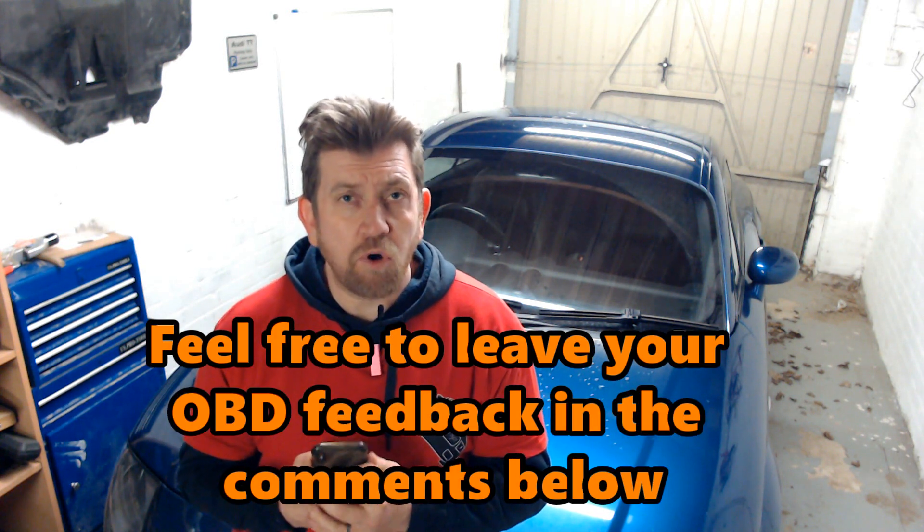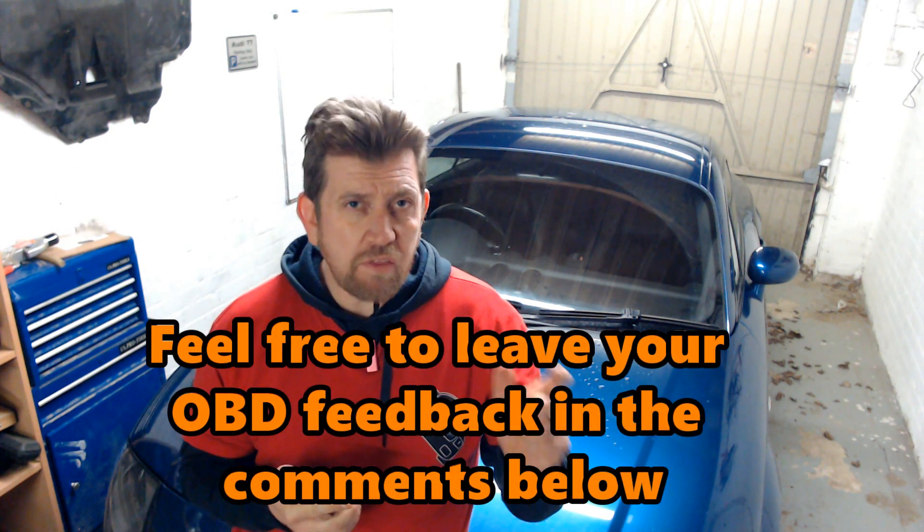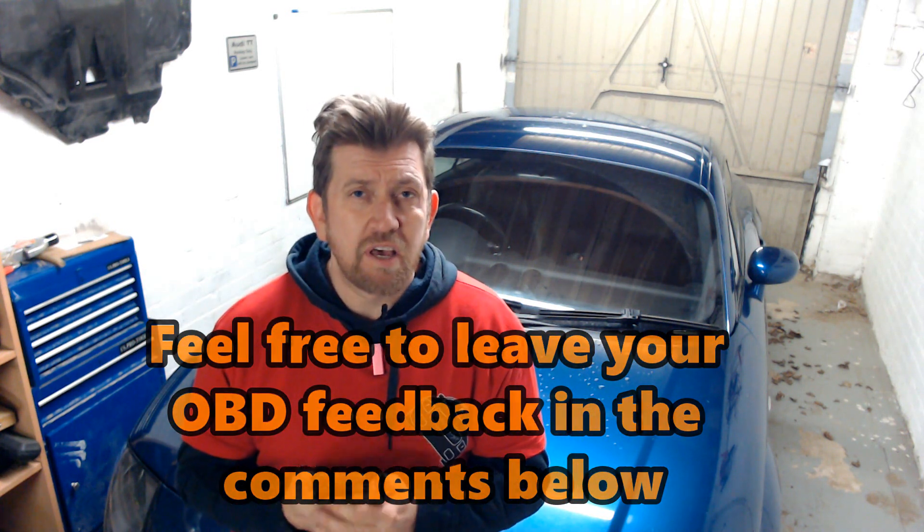It also saves a hefty garage bill. I would say, if you're doing any maintenance at home on your Audi TT, then one of these dongles is an absolute must for your toolbox. In fact, if you're taking the car out anywhere, I would keep it in the glove box. That way, no matter where you are, if an engine management light pops up on the dashboard, you can scan the car and find out the problem. One of the great features of these apps is they not only read the codes, but you can also click delete to clear them, removing all old error codes from the system.